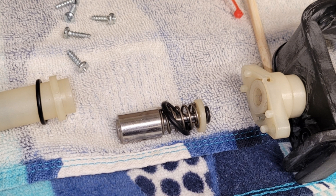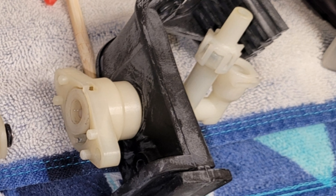I kept that plastic T on top of the motor and put it hanging on a cup — that rubber piece stays attached to it on the top. I couldn't figure out a way to pull the rubber piece off, so I just pulled all the guts out of the T on the top, as shown in that picture, and poured vinegar — regular white distilled vinegar — into the plastic T and let it sit, balancing on a cup. I did that a few times until I could blow pretty clearly through it. At first I couldn't blow air through it at all, so it was clogged. I could hear the vinegar eating away minerals, so I knew there was stuff in there.